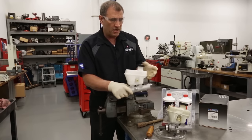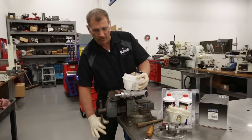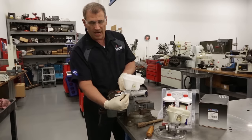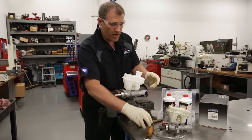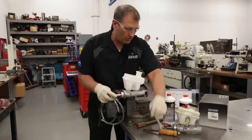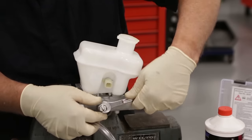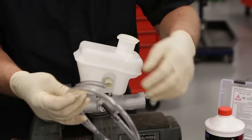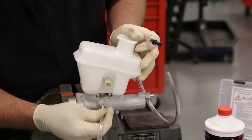I've got my fittings in here — I've got to snug them up. Let's get the master cylinder installed in the vise. I've got a set of soft jaw clamps here so I shouldn't cause any damage to the backside, which could affect your sealing there. Next step is to remove the cap and get my fittings installed and snugged up. You don't have to over-tighten these — they're all aluminum. You don't want to cause any damage, but I don't want any air to leak in or fluid to leak out. I want to make sure I don't damage the threaded areas.